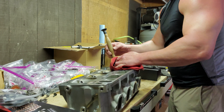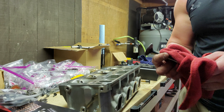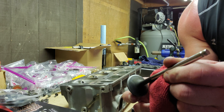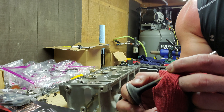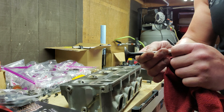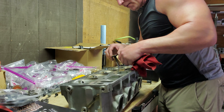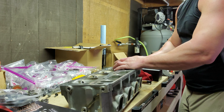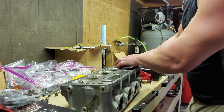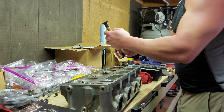It's important to get all the compound off. Now if you look at the valve, you can see the surface is cleaned — it's a much cleaner surface on that angle that seats on the valve seat. You don't need much; you don't want to take any real material off. You just want to clean the carbon off to where you have a nice seat from the valve surface to the valve seat. When you turn it, you can feel it's nice and smooth — you can feel that seat much, much nicer.